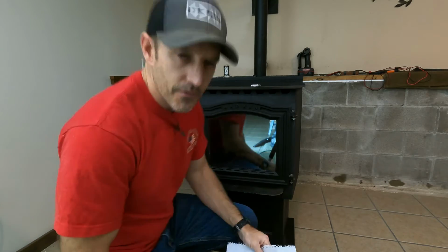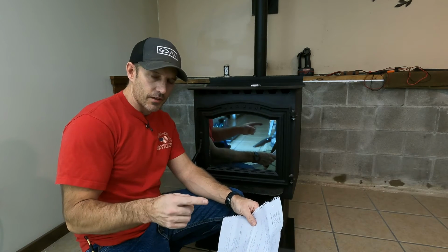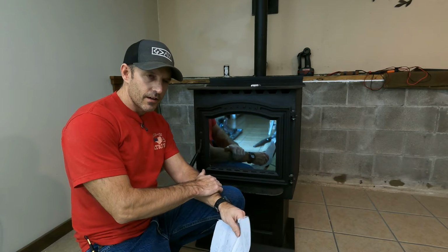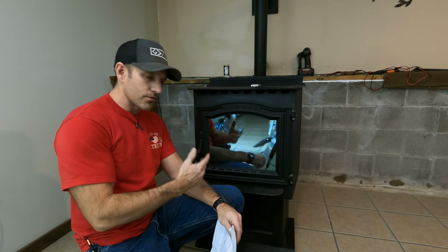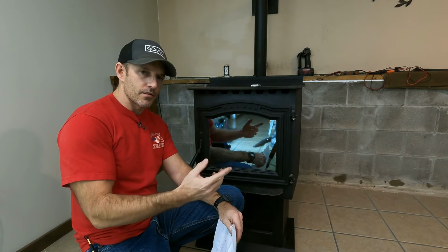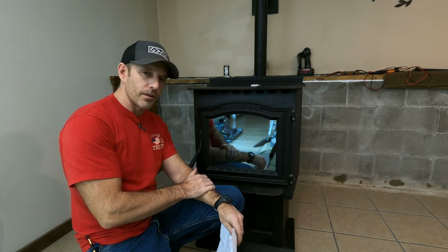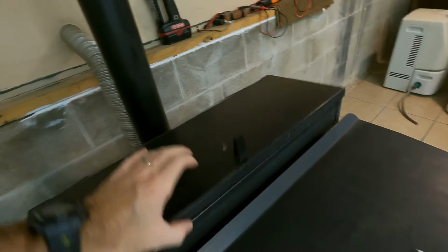All right, that's the 5 blink status. Now we'll go on to a 6 blink status, which I think is probably one of the more common ones that people will get. In the 6 blink status, most likely you just need to give your pellet stove a really good cleaning. So I would recommend watching my end of the season cleaning because I clean everything on this pellet stove. Another 6 blink status cause could be that you're out of pellets.